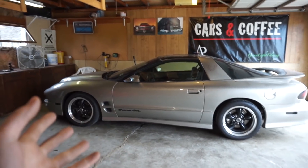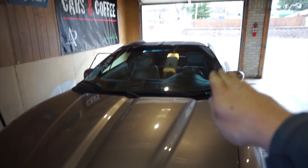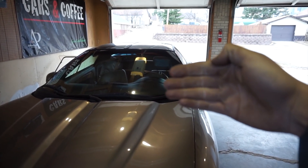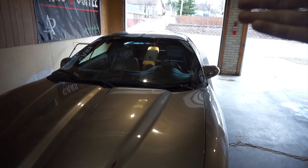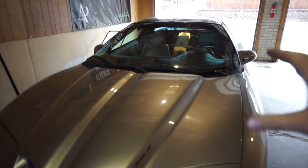Now, on these cars, and I'd imagine others after actually looking at this one a little bit, when you put moderate pressure on the brake pedal, the master cylinder and brake booster actually pump a little bit. What this is going to do is solidify it so it doesn't move at all. People have been known to have their firewalls tear in these cars from that repeated braking and flexing. I'm going to prevent that and hopefully get a good brake pedal feel.